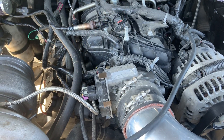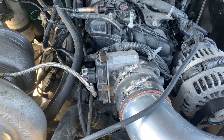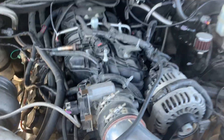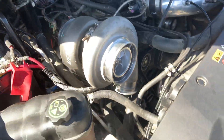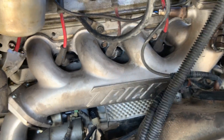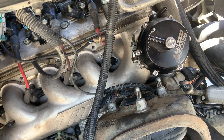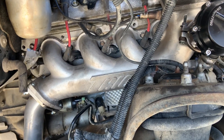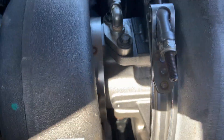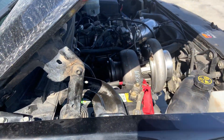I'm not necessarily particular to Wiscos - I like CP Carrillo bullet series pistons. Wiscos are fine though, and this customer wanted them so we went that route. These are stock LS3 heads, 823 castings with a good valve job, no porting, trunnion upgrade, with a pretty good spec'd cam by LG Motorsports. Then we are running what I consider the very best hot side you can run for these trucks: a Trick Performance T6 manifold - gives you room to your plugs. It's a true divided T6 manifold.